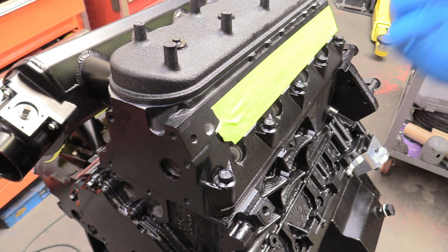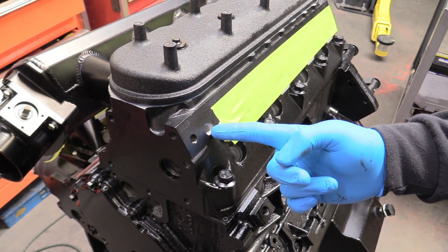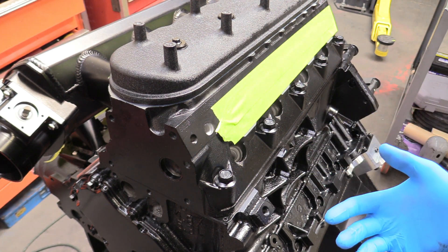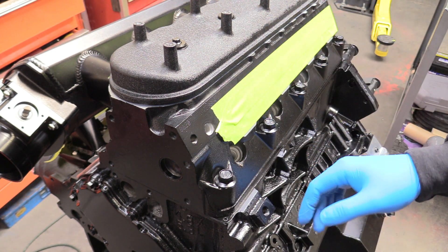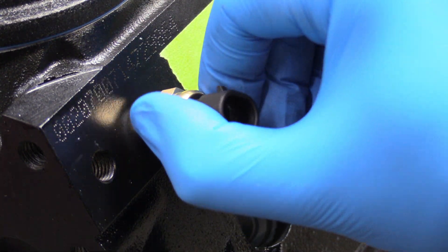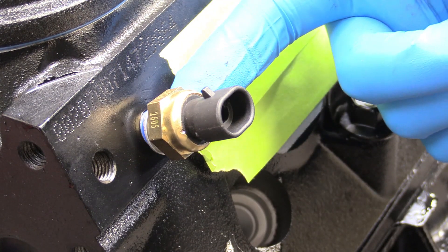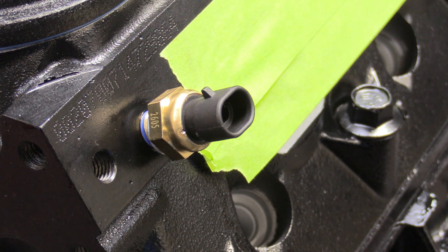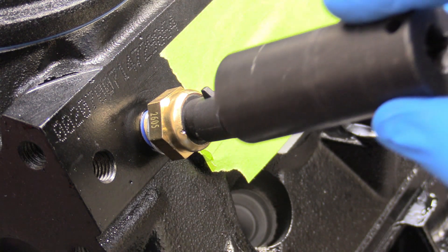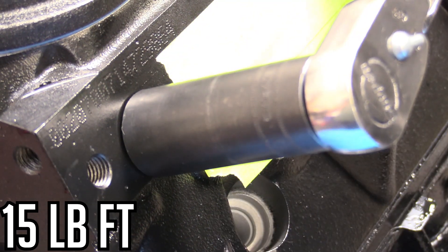The next thing we can worry about is our coolant sensor port, and that is right here on our driver cylinder head. Now if you put this cylinder head on the other side, you're probably fine because in a hot rod application you can just make the wires longer. It's supposed to go on the driver's side in case you want to use a stock wiring harness. We can replace our coolant temp sender there, using fingers on the metal to start it. It doesn't require any kind of sealant — it came with it from the factory. Then grab our 19 millimeter socket and snug that on down. Don't go crazy — it's in an aluminum head.